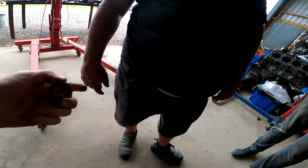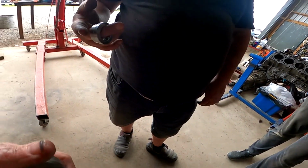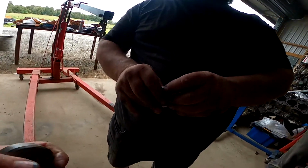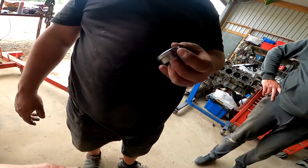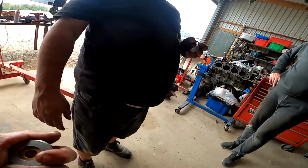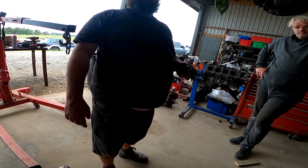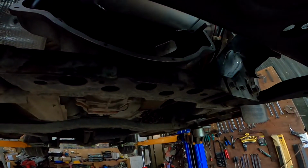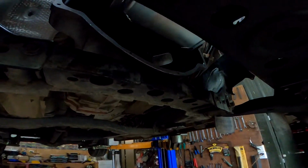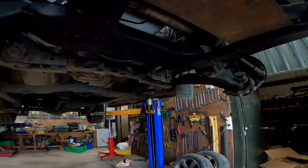Yep. I would go with that one with a few mils machined off it. Machine the inside of it and push the bearing back in further. Or machine the inside and push the bearing back in further. Either or. Oh, hang on, I'll just put them on my magical lathe. Yep, you do that. That's not clearance. It's more than it had.